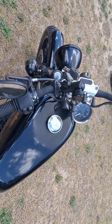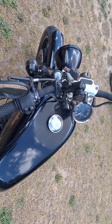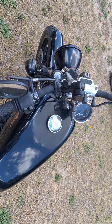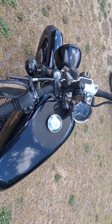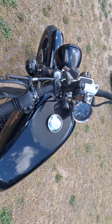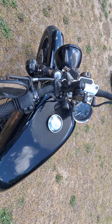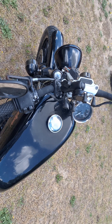If you're losing power, it's usually not your jetting that's off. You're revving the hell out of it and you hit 5,000 on a Sportster — 5,300, 5,400 — and it feels like it's starting to shudder a little bit. That's usually the rev limiter doing that, not the jetting. I've seen guys go through jetting, jet it and jet it, and they end up with an entirely too big or too small main jet when the whole time it's been the ignition module rev limiter killing the power. You guys have a great day.